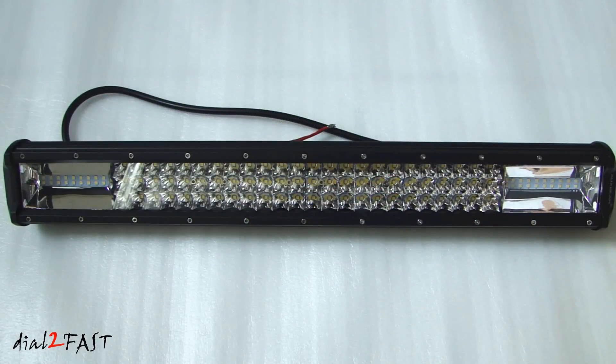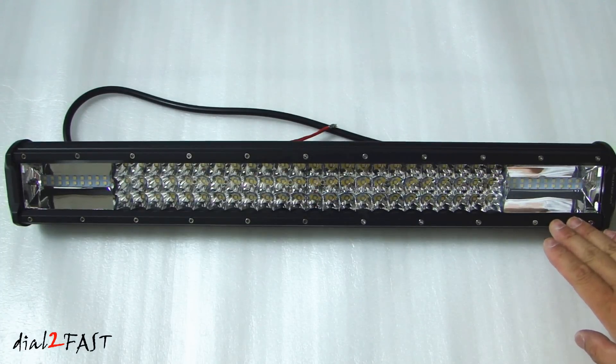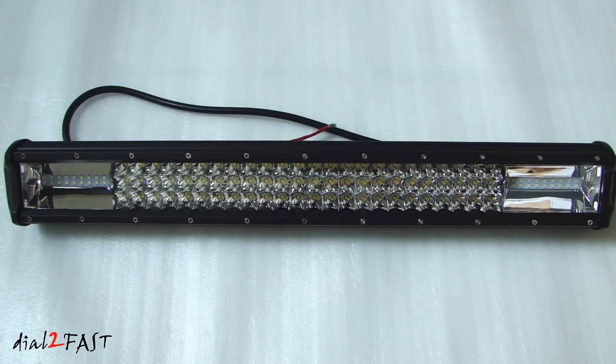As you can see from looking at this light bar, the design is very unique. In the middle, we have a very high density array of LEDs. There are a total of 72 LEDs for this 23-inch model, and each of these individual LEDs have its own reflector cup. On the side, we have an additional 18 LEDs, and also another 18 LEDs on the other side — these act as a floodlight. So the middle part is your spotlight and the side is your floodlight. The beam angle of the spotlight in the middle is a very focused 10 degrees, and the side floodlights have a beam angle of 150 degrees.